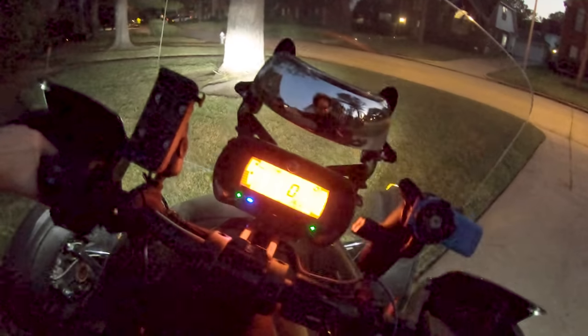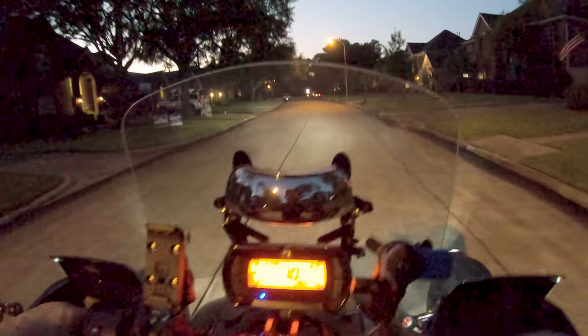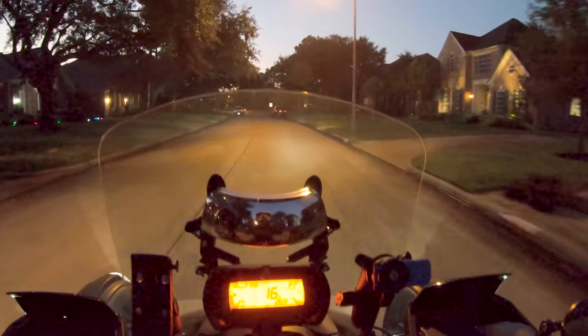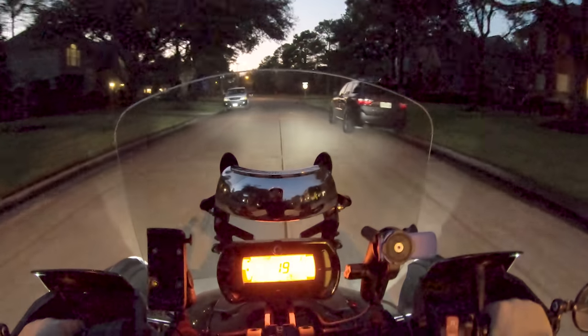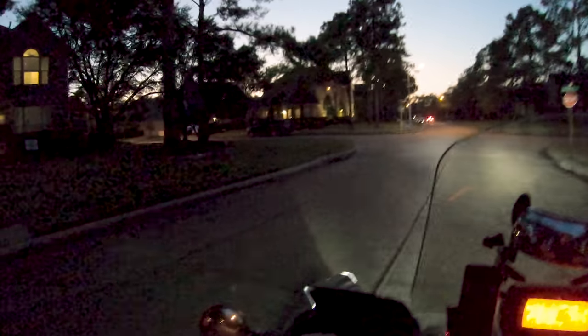Okay, so now it's time for the obligatory test ride. Is it a ride or a drive if you're on a Ryker? Handlebars, so that means it's a ride. Okay, so, you know, if it doesn't stop or the wheel falls off, that means I missed something. I had Discount Tire set it at 36 pounds in the back, which is a little high, but again, this is a regular automotive radial, so that's probably a pretty good pressure for it.